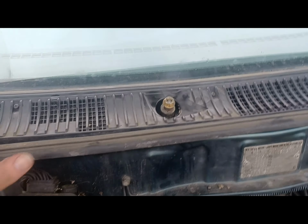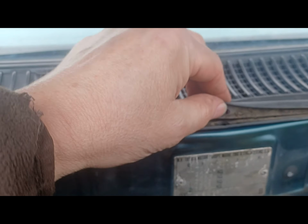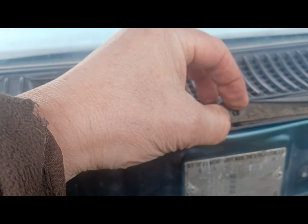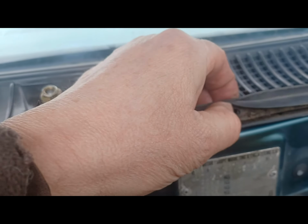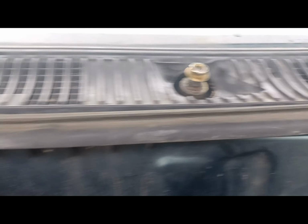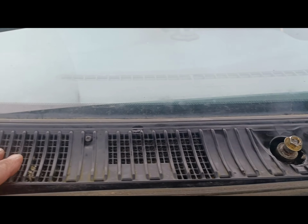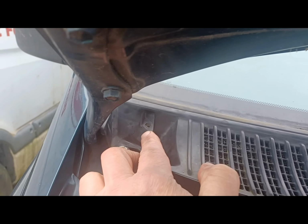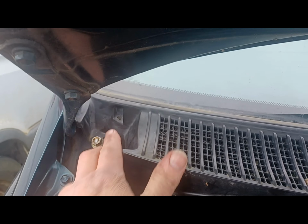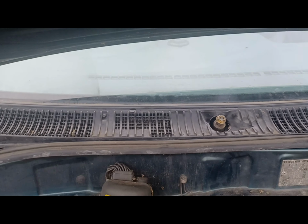So the scuttle panel's back on, checked it, it's all back in position how it should be working. The front is retained by these little trim clips. They're like a T-head, they fit in the rubber and then clip through, but unfortunately most of them have succumbed to age, like most of us do. So you can see, I'll get my finger out of the way there. So what I've done is just loosely fitted the self-tappers in the top here, because you've got a little bit of movement to line everything up. The top 2 screws each end are the worst ones. You normally have to access those with the bonnet down. So screws back in, wipers back on, job's done.